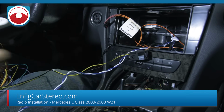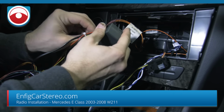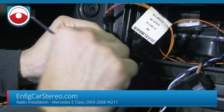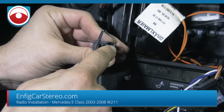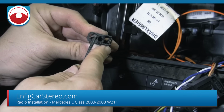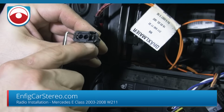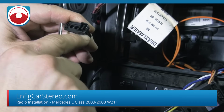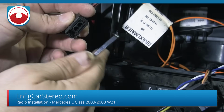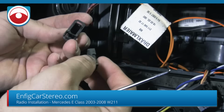So the fiber box has a connector already in it. Just pull that one out. Okay. Now, we're gonna try to get this connector with, there's a push-in that to keep it from getting dirty, but for now they come with this. So you can do the same thing you did on the other one. Just push it off to the side and use the pick to bring it out. Be careful not to stab any fiber. If you stab the plastics, no big deal, but fiber is not that delicate, but it can be broken, and if it breaks, you have to get it repaired, and that's expensive.